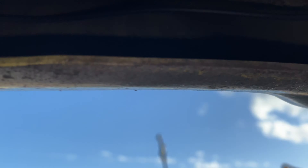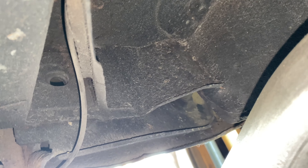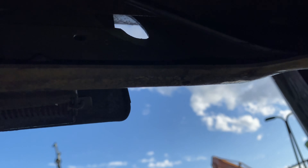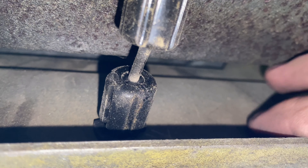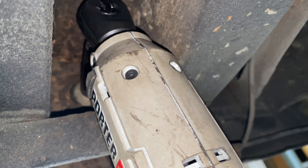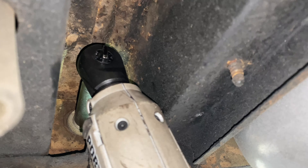There's a wire right here and a rubber grommet. We're going to try to fish that through there. Once you unplug the wire and get this grommet — I had to kind of trim mine because it's so hard and brittle. It's just the nature of the beast when you deal with these old rubber grommets. Push that through the hole here — that's for the license plate light.